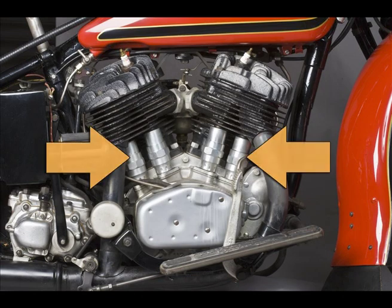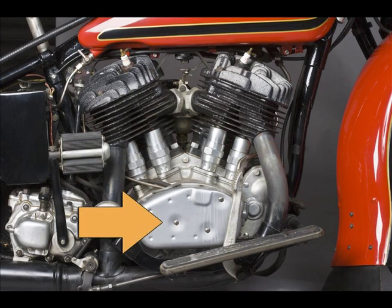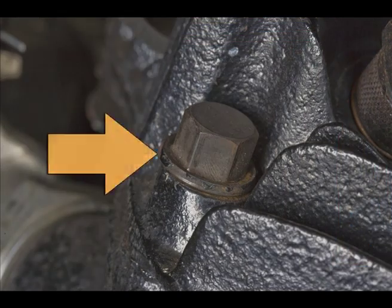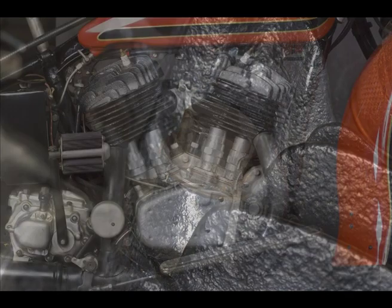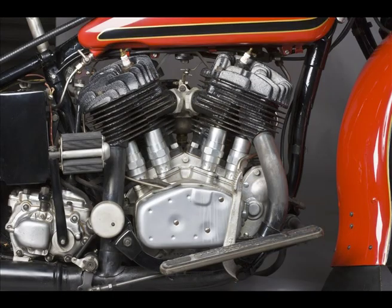The valve covers are cadmium, as is the one-year oiler cover with the underside cut away. It's the first year for the new bigger washers under the cylinder head bolts, and first year for the 9-bolt heads, replacing the earlier 7-bolt ones. I don't see any faults.